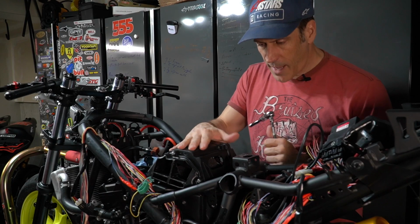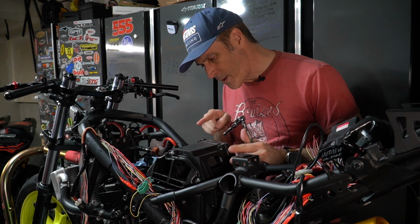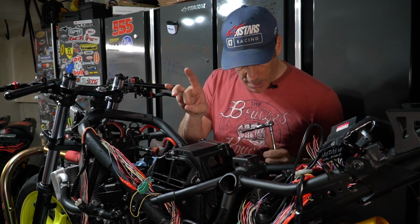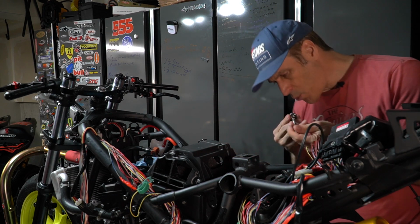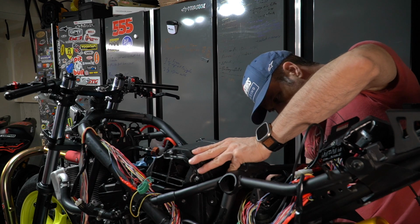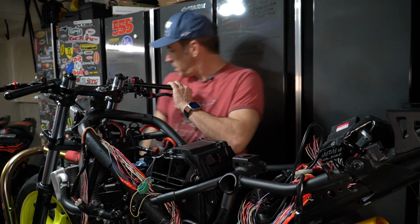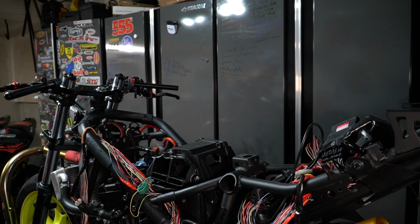Okay, so I've put the air box back in place here. Everything is properly aligned. I have easy access to the bolts for the clips. And I have my 10mm socket with the bolt that will hold the air box in place. So I'm gonna screw this in place here. All right, so this is nice and solid. I'll attach the bolt on the other side.